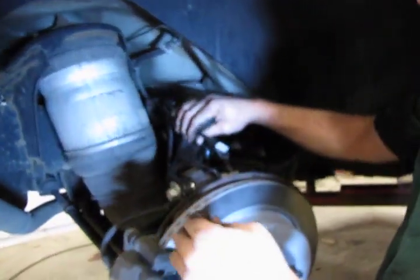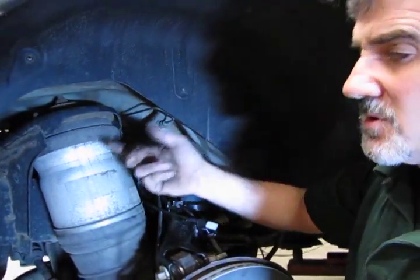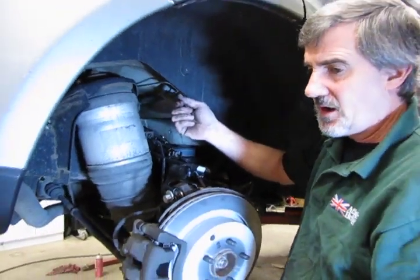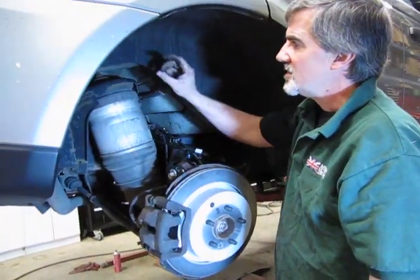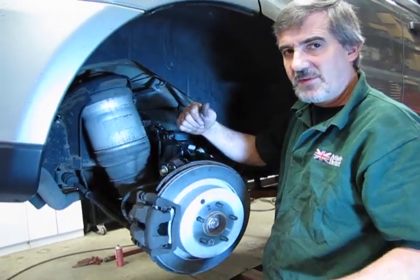If you don't hear a click and you can pull the connector apart, sometimes you can actually have a dry seal on there and they just don't want to go together well. What you can do to cure that, like in this case, is exactly what I have. You can take some electrical contact cleaner, Electromotive, Wurth, and squirt a little bit on that connector, and when the seal's a little wet, it will pop in and it'll click.